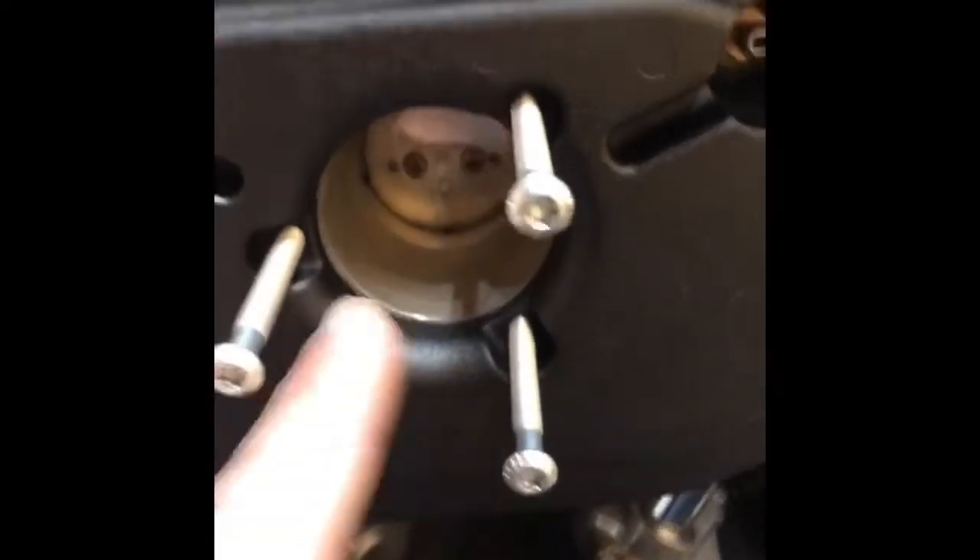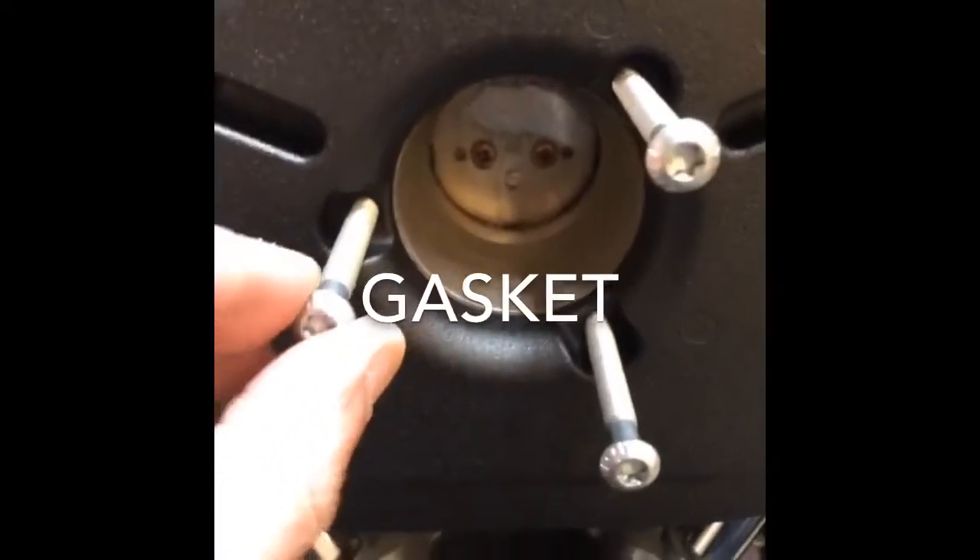We're making progress — the hardest part so far was taking out the original cover, for some reason that thing was on really tight. I'm trying to hold the washer and gasket in place while installing, and I noticed the washer kept moving, so I took the original bolts and put them in there just to hold the washer in place, because the new bolts have a thread locker already on them and I didn't want to engage that just yet.